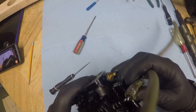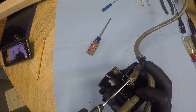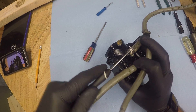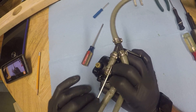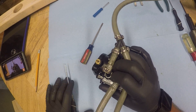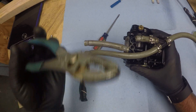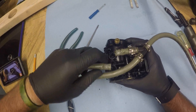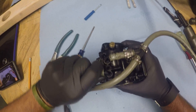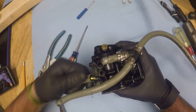All these fuel lines will be replaced. These are the old gray fuel lines — they have a tendency to break down over time and clog fuel filters, clog jets, rendering the ski inoperable more or less. You'll see just prying that clip up releases with a nice click. Slide that out of the way and then we're just going to gently make sure these fuel lines are loose. Give them a quick twist with the pliers, very gentle, making sure we don't damage any of the fuel nipples on the carburetor. Those are all pressed in — if those get damaged, the carburetor has to be replaced.